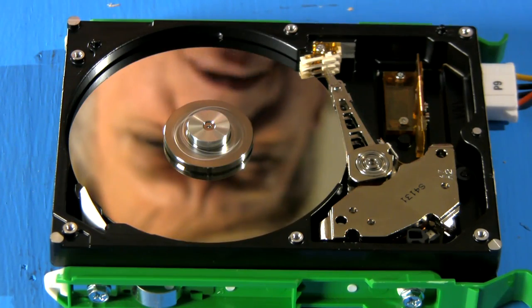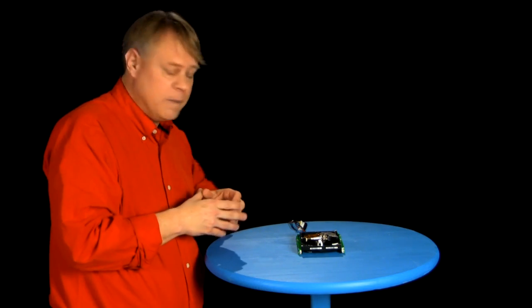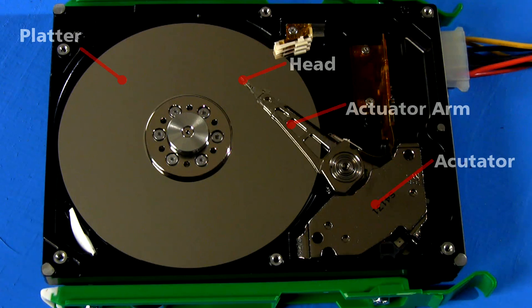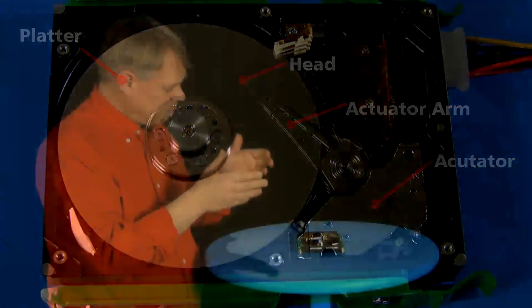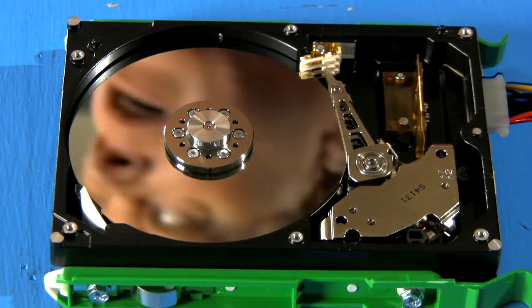It's an ordinary hard drive, but its details, of course, are extraordinary. Now, I'm sure you know the essence of a hard drive. We store data on it in binary form, ones and zeros. Now, this arm supports a head, which is an electromagnet that scans over the disk and either writes data by changing the magnetization of specific sections on the platter, or it just reads the data by measuring the magnetic polarization. Now, in principle, pretty simple, but in practice, a lot of hardcore engineering.